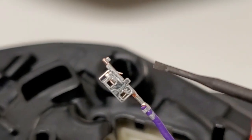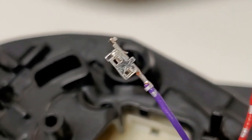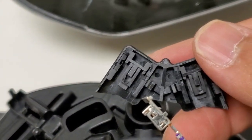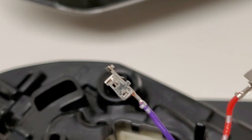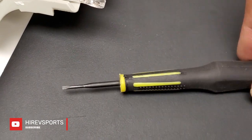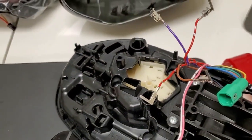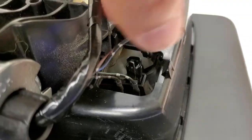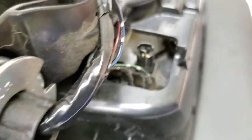Make sure to take a picture so you don't forget which wire goes where. You press this small pin that's kind of sticking out, press it down to remove the wire from these channels. Sometimes the pin gets flat so you have to lift it up with the smallest flathead screwdriver possible — push it in and remove the pin out.